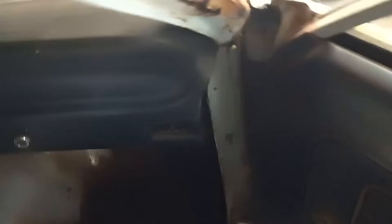This is another reason why I'm doing the whole roof — you can see even this area down here. I'm getting a cut down here at this little section, and I'm going to drill out all these spot welds and cut it about here. Before I put the roof on, I'm going to graft all this in first.